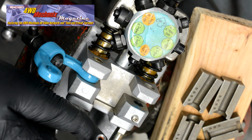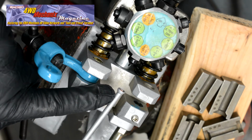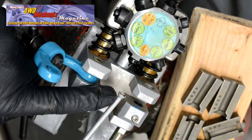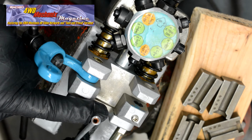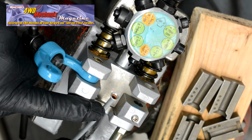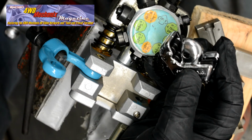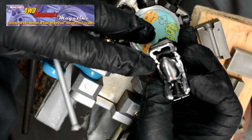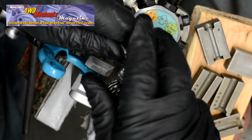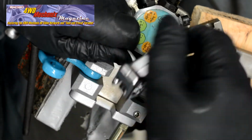This is an insufficient flare. The flare shoulder is mushroomed. The shoulder is too thick, and the lap is not complete to the bore diameter of the tube. The mini tubing cutter will remove just the flare head, removing a minimal amount of material from the tube. We can form another flare.